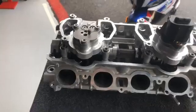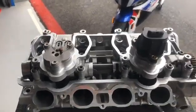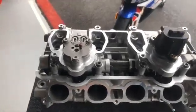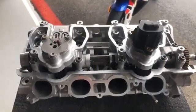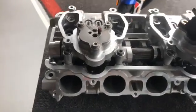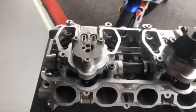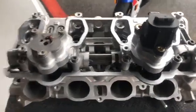With normal engines you can run a soft cam which will get you lots and lots of torque off the bottom end but then you compromise top end performance, or you can run a hard cam which will give you high end performance but then compromises all your low end torque. So with the shift cam technology what they're basically doing is giving you the best of both worlds. As the revs rise up you'll be on the soft cam, and then when they come to above 9000 RPM they'll go on to the hard cam.